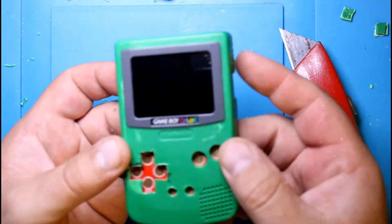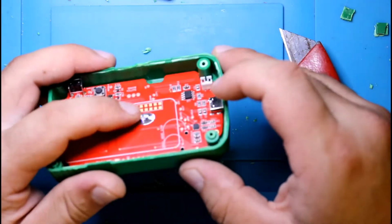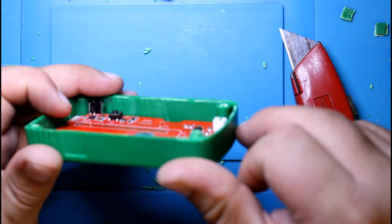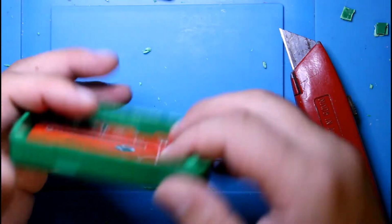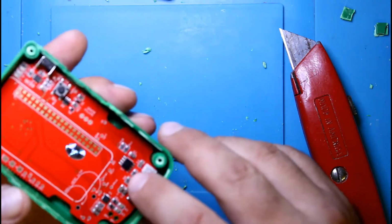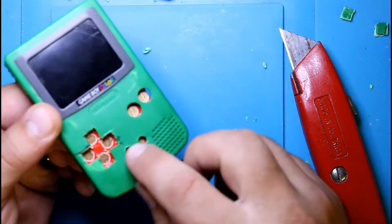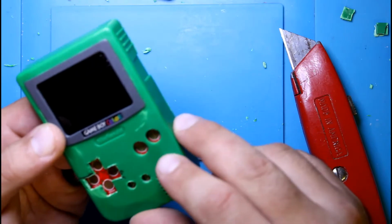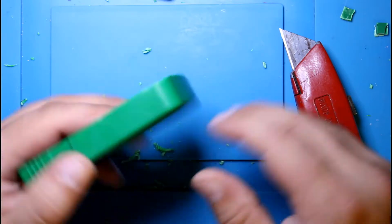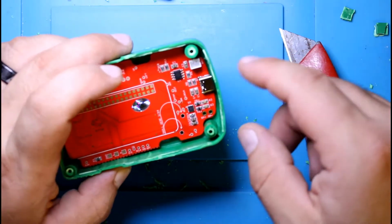Okay. Now if you notice, because of the way the screen is and the ribbon connector, the board is not really flush. You'll see just slightly angled down if you look over there. So when this is all set, ready to go, you're not going to have always the best contact maybe for some of the buttons. That's something that kind of sucks just because of the screen, which is why sometimes it might be good to use the dome buttons, but if not, not a problem, because I built one without the dome buttons.